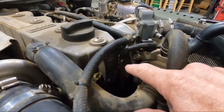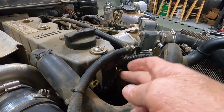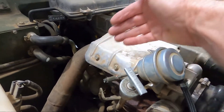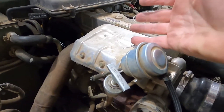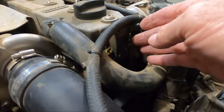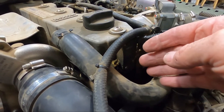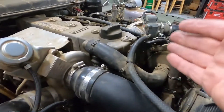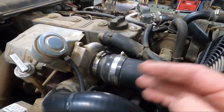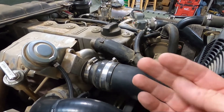For whatever reason they want to limit this. If there's no control signal going to this valve it's going to let the full psi flow through, so if I have 15 psi of boost I'm sending 15 psi to my wastegate valve, which opens a flap inside the turbo and lets exhaust divert out so it doesn't spin the turbo as much, decreasing the boost. The transmission computer limits the boost that comes through here — when it's signaled it limits boost to 7 psi. 7 psi is not enough to open the wastegate.